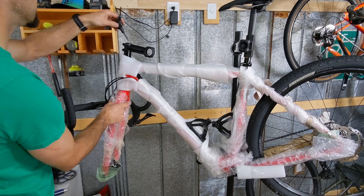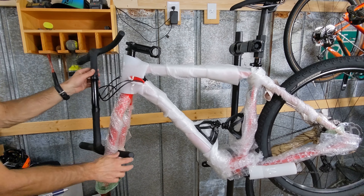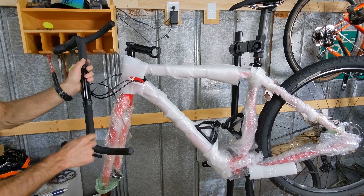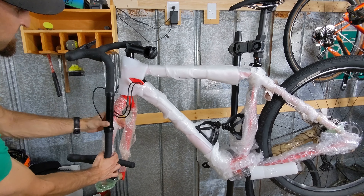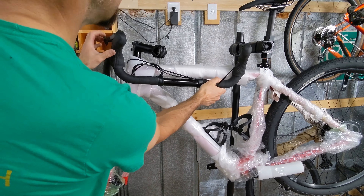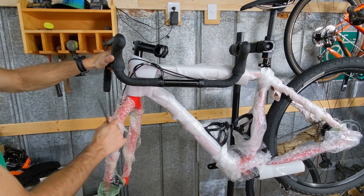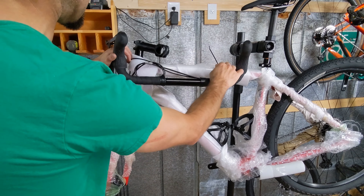We'll also need to put some protection on the levers. I've got the stem facing backwards now — I'm just going to tighten this down a little bit, just make it snug so it stays there. These handlebars are pretty wide — they're the Salsa Cow Chippers. Since you already have padding on the bars, use that for protection when you ship. I'll probably move them down in that area and zip tie them to the fork. Another option is to run them along the top tube if there's enough space. A lot of times I won't position them until I drop the bike in the box and see where they fit best. Also, if your fork is sticking out too far in the box, you can spin the fork around to take up less room.